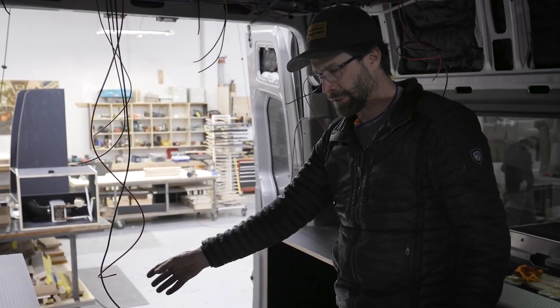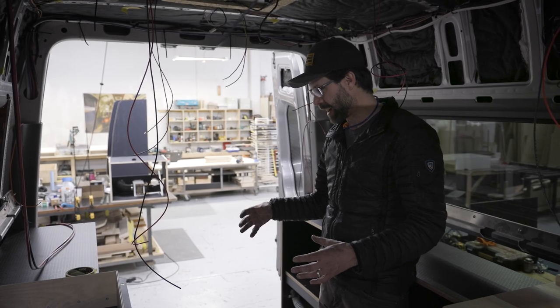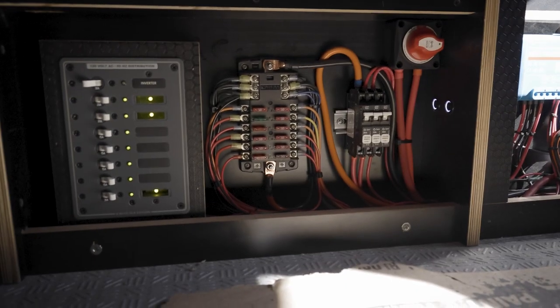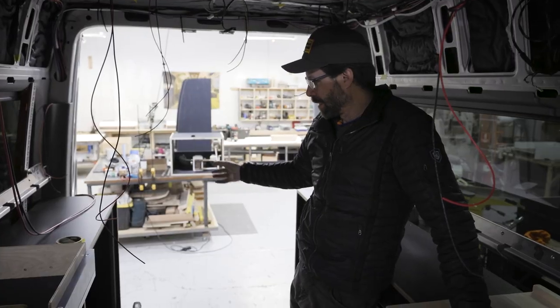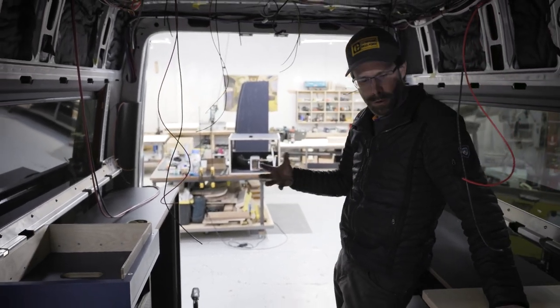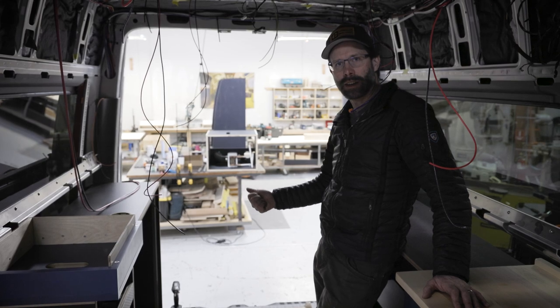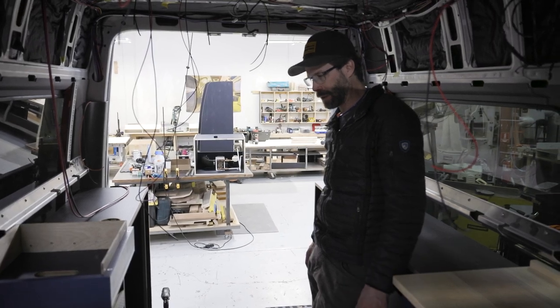Over here is going to be our electrical system. We're going with a 48-volt system, using the Dyness 48-volt batteries. I think we're doing one — there's room for two in here — and it'll be a full Victron-based charging system, inverter, all that good stuff. Additional electrical will be solar up top to support it, and we're doing alternator charging off of the chassis motor. So kind of a cool, lightweight build in terms of having hot water, having good power, and being off-grid ready for that overland lifestyle.